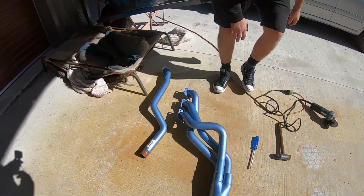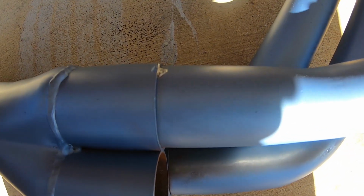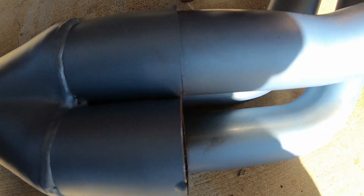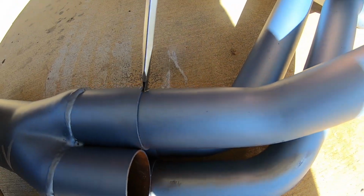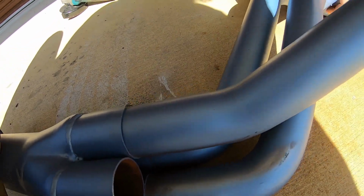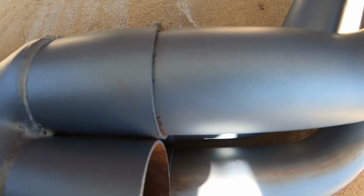It's way closer already. So close, guys, but we don't want to stretch the bay. Alrighty, let's get this one off, take it off at a right angle. So we've ground that weld there, give her a bit of a wiggle, might need a touch more. It's coming out of the back there. Might just need a good hit to split it. You don't want to hit it too hard to oval it, but just to crack it. Yep, did you hear that, guys? So close. It was just a tiny slither of steel, but it's cracked now. Heard it pop when I let go.